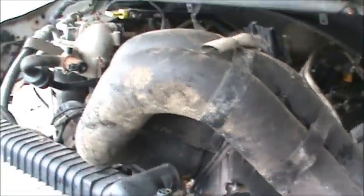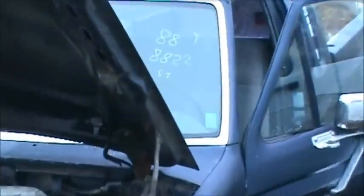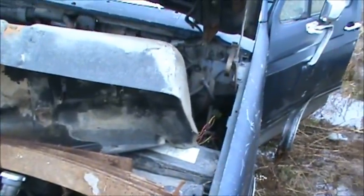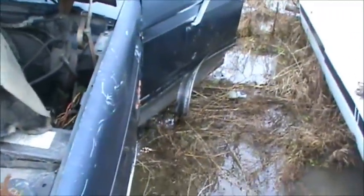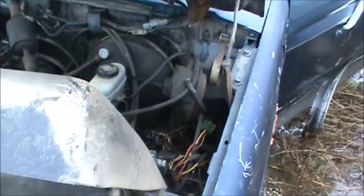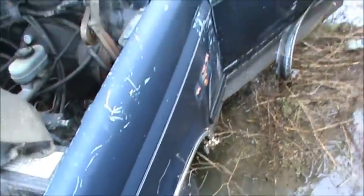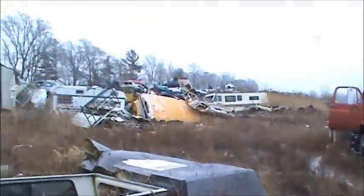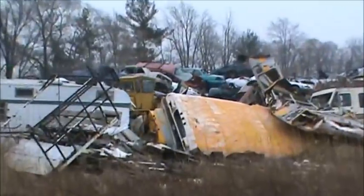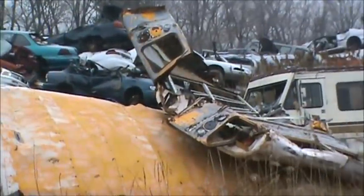This is a big old gasser. For this '88 Ford — you can tell it's '88 because it says it right in the windshield — you take that 10mm there, then peel back the kick panel, then take the 8mm that holds it into place and take it out through the inside. This is an old-style F-150. There's some fun over there with the loader — even a car pile toppled over.